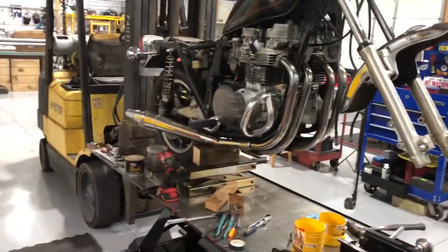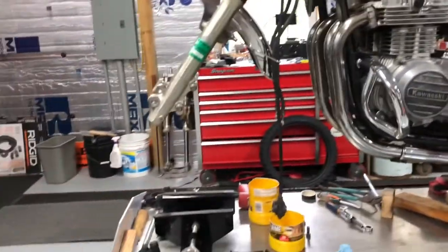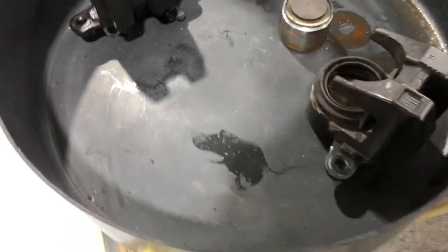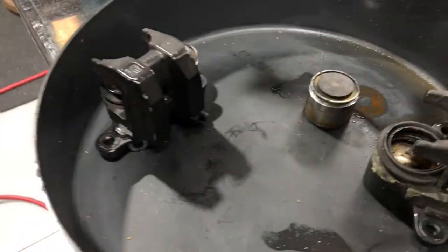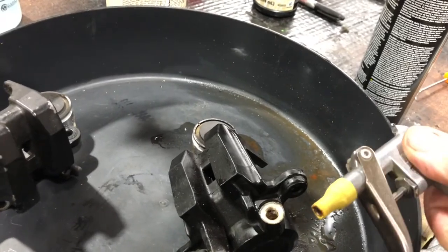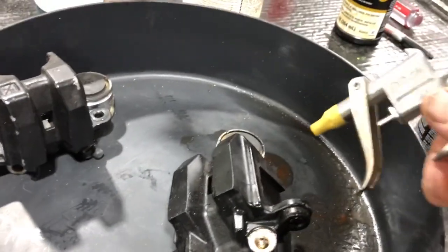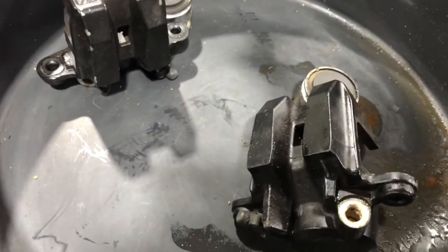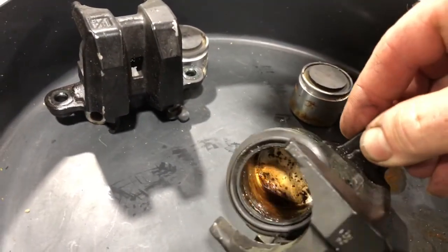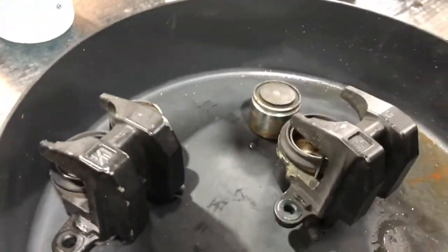Front tires next. It helps to have a forklift or a lifting device with a big heavy pig like this - I don't know how much it weighs, it's heavy. Got to do the treatment on the front brakes too. These ones weren't happy. Both front calipers - I got the pucks out. If anybody's wondering how to get these pucks out: you use your air gun. I put a piece of shrink tube on the front of it so it doesn't damage the threads. You want to stick a rag where the puck is and blow air and it pops the puck right out. You got to be careful though because man, it comes out fast. As you can see these got some goo on them - brake fluid just turns to goo - and that's why these were hanging up. When I first got this bike you couldn't even push it. So between that and a new front master cylinder, I'm going to flush the lines out.